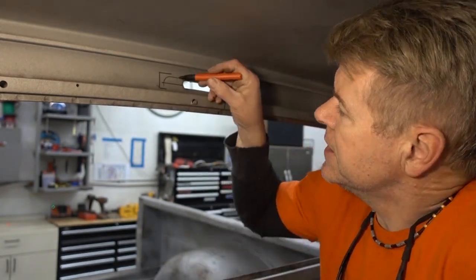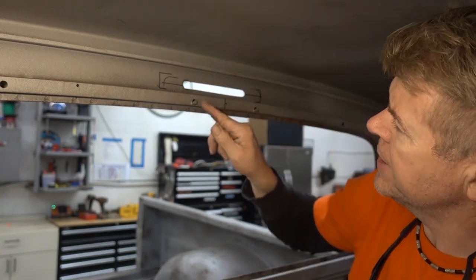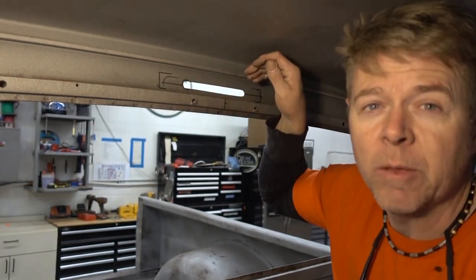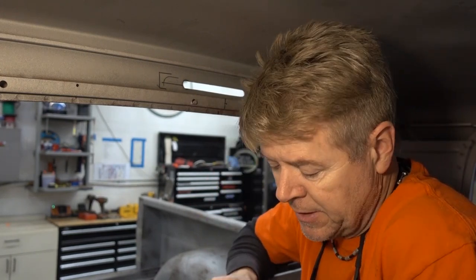To make this work instead of cutting down the tabs, the headliner comes down right along here. I'm going to cut out this top strip on this cab so the box can slide in and then go onto the tabs. That's going to be the more effective and cleaner install for down the road if somebody ever has to change this tail light. The other way, the tabs would have to be cut nearly flush because there's less than a sixteenth of an inch of clearance — there's just not enough room to thread the nut on.